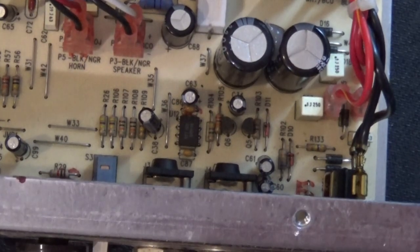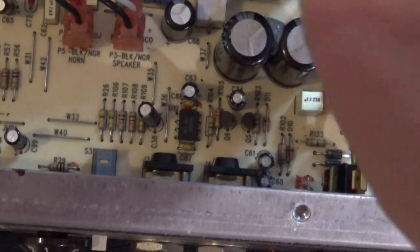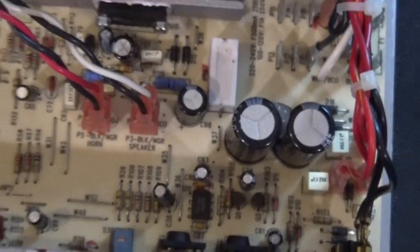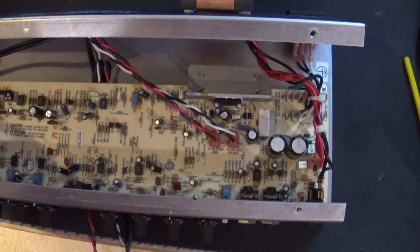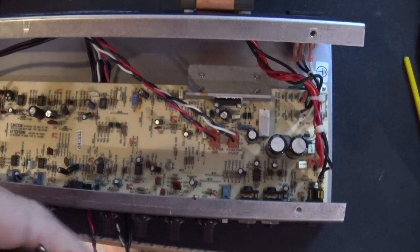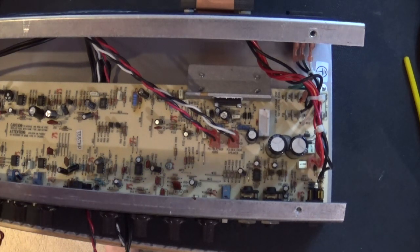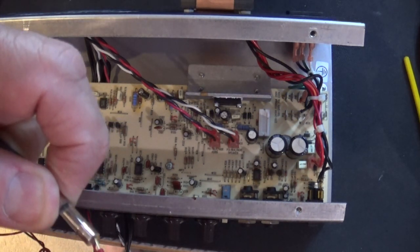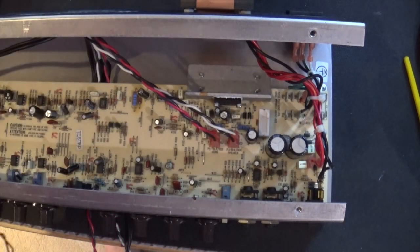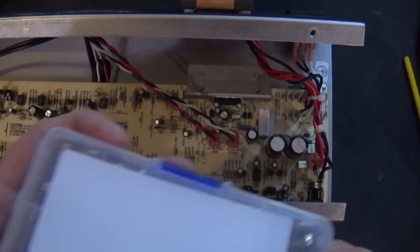So the first thing we're going to do is check this fuse. Let me pop the fuse out — it's not plugged in, obviously. I'm going to pull this camera back a little bit so you can see what I'm doing. We're going to take our meter and check the fuse out — put it on continuity. It's open. Open fuse. Let me get my fuses — I've got this whole kit of fuses right here.